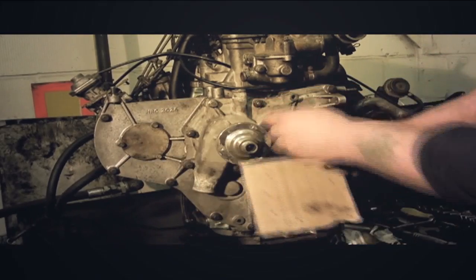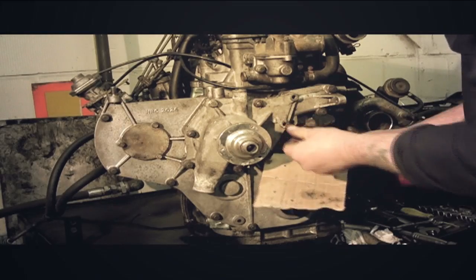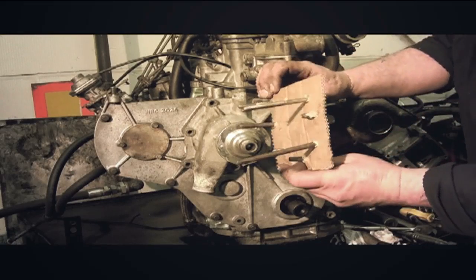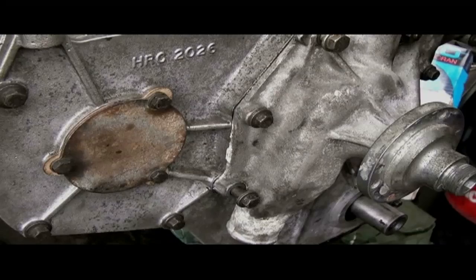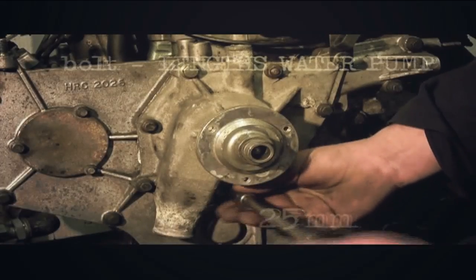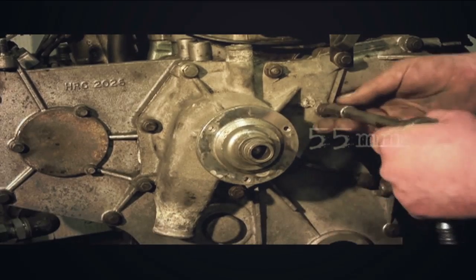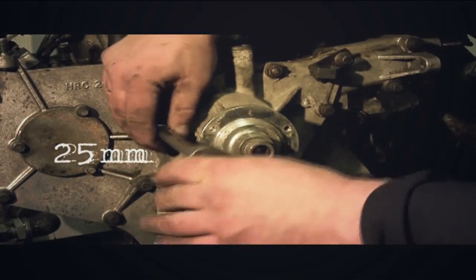You've got your water gallery bolts — the three on the right-hand top corner — that is where the water comes from the engine block. These can snap, they'll be corroded quite badly, so take it easy with them. You have to inspect the condition of them when they come out to make sure the threads haven't corroded badly. All the bolts are different lengths. The bottom one is 25 millimeters. The ones in the water gallery are 55mm, and then you've got 25mm just in the casing.